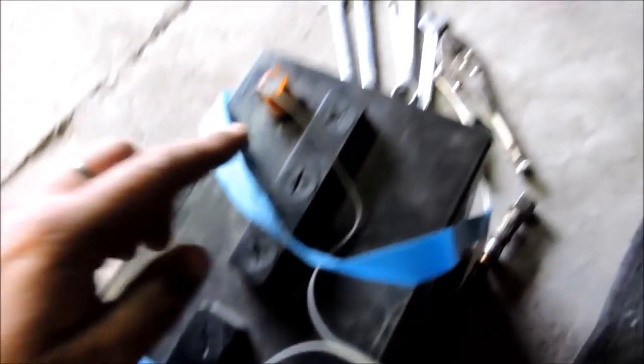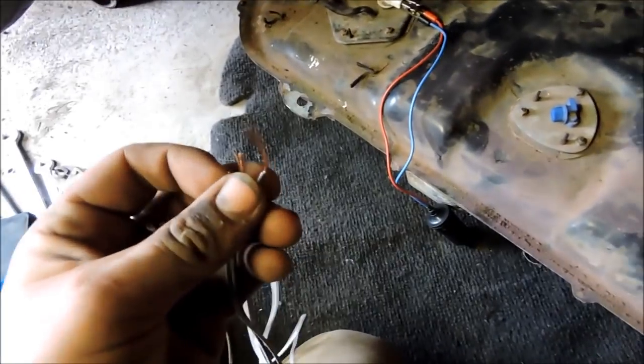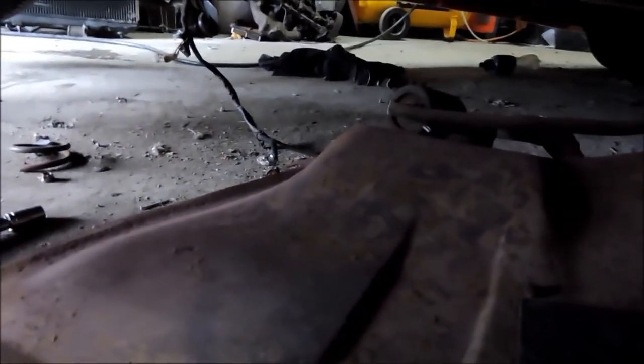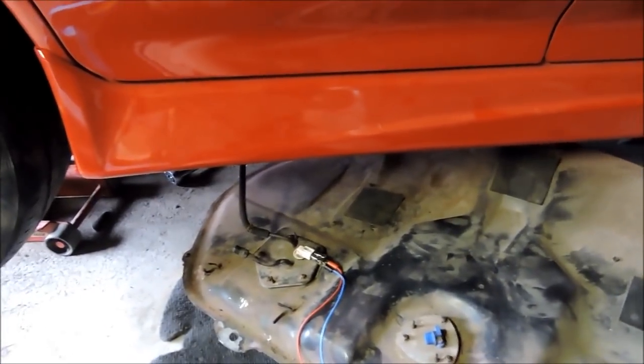So I'll get a battery and some wires and probe them into the fuel pump connector to see if the fuel pump goes. I've taped some wires on the positive and negative and put some roach clips in there. The fuel pump is definitely working. So now I'll get my multimeter and get under there — turn the car on and see if there's power at that wire. See if there's any power coming to the fuel pump when I turn the key on. If there's no power there when you're trying to crank the motor over, I'll have to run wires to it.